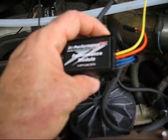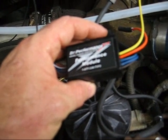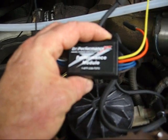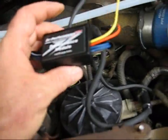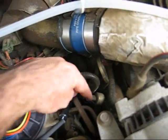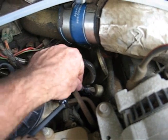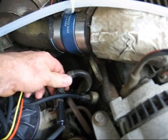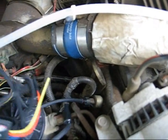I did a couple of miles per gallon tests without actually measuring anything — I just went by the gauge. If the gauge info holds up, I'll be pretty happy, but I'm going to do an actual test later on and we'll see what it looks like. The install is incredibly easy: you just unplug your ICP sensor — that's something to do with the injection pressure — and plug it into the other end. That's all there is to it, pretty much.